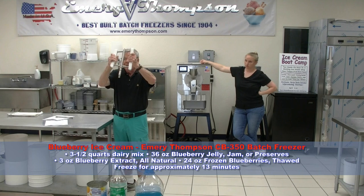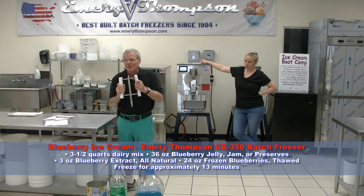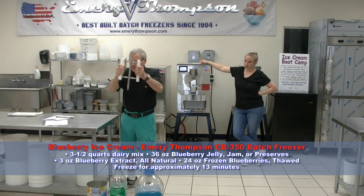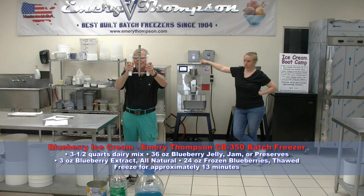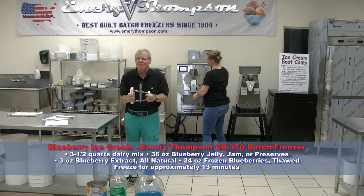You don't have to hire someone for $90 to do it. If you want to pay me $90 and I'm not busy, that's a pretty good deal. I'll come down. But that's it. So there's your maintenance. And the once a year maintenance, can you see those 2 black rings on there? Those are rubber gaskets. You take a butter knife and you roll it off and throw it away, and then you roll on a new one. And that's once a year. You've just performed the entire maintenance on the whole machine. So that's pretty easy.